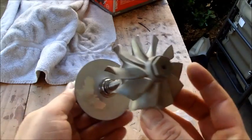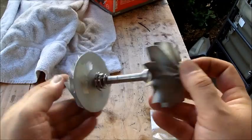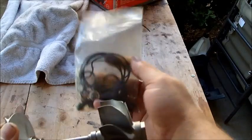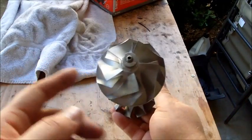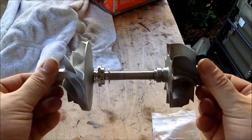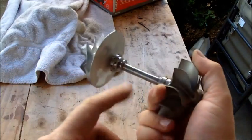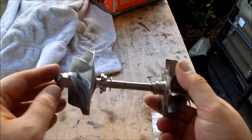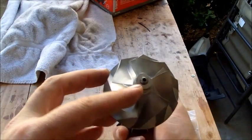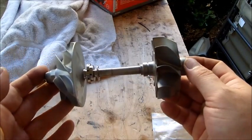It's my new 360-degree carrier ring. Basically this is what you get after you buy the 360-degree thrust bearing kit and a Wicked Wheel, which will run you around $150 if you contact them and tell them you watched this video. What you do is tear apart your turbo and take them the exhaust impeller and the shaft. What they'll do is balance the whole thing out, put your new wheel on the end, torque it, make a witness mark, and balance the whole thing down so that you're ready to go. Then you can rebuild it with the 360-degree kit.